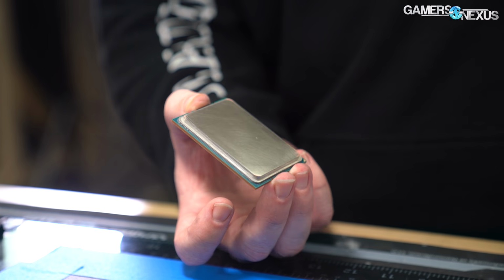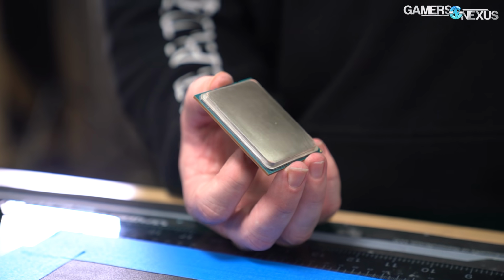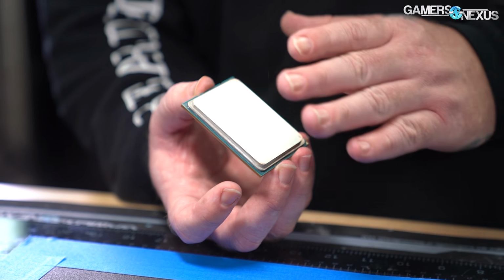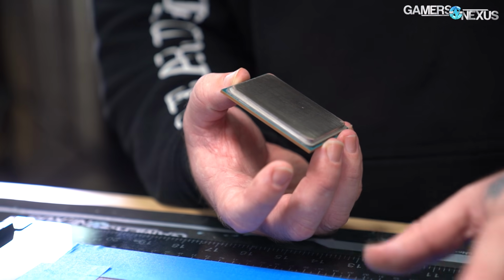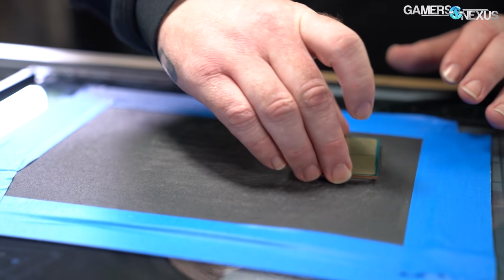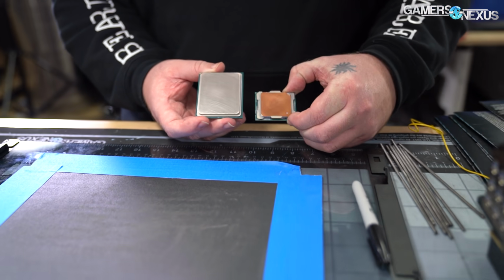It is shiny. Yeah, and then the copper piece, so you can tell. What I want to do is get it all down to copper. The reason why I want it down to copper is then I know it's completely even, because that means all of the nickel plate is off. So that's how you know. Even if you put a piece of sandpaper over here, you're still going to get that same effect. Yeah, see, look. That's what we're going for, that copper finish.